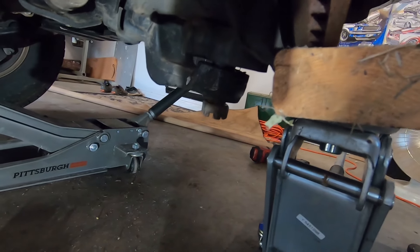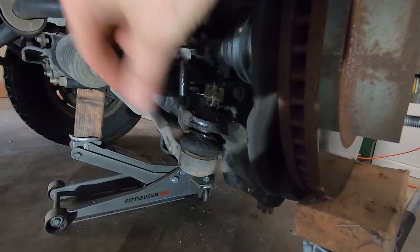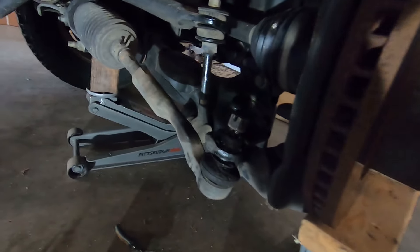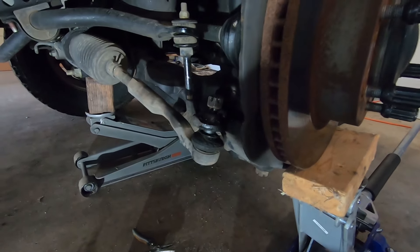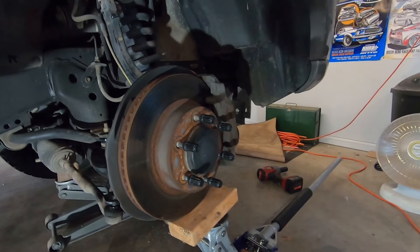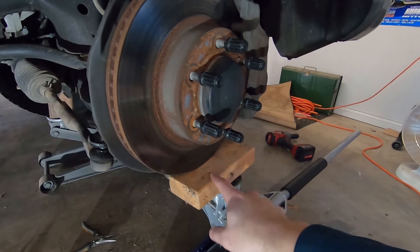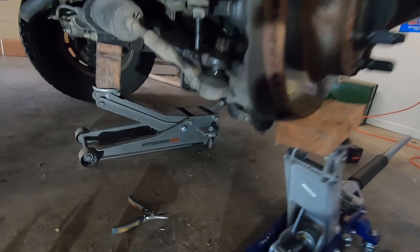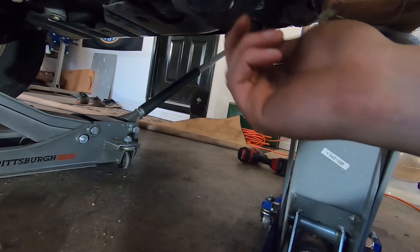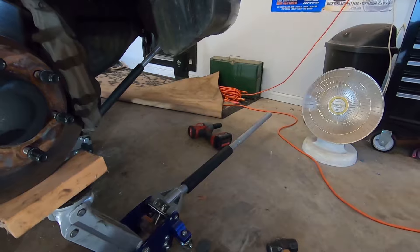You can use special tools, but what works for me is you loosen the nuts, and then on the ball joint housing itself, whack the crap out of it with a big hammer. It took me probably 30 seconds of whacking it right on that section — it loosened up and got free. I sprayed some PB Blaster on there. Once you remove the tie rod, the whole knuckle moves around more freely. Put a jack with some wood on the hub and rotor to move it out of the way, then whack the lower ball joint housing until it gets free. Then you can lift these right up and replace them. There are four bolts down here — I zipped those out. Without the impact wrench, I don't know how I would do this job.